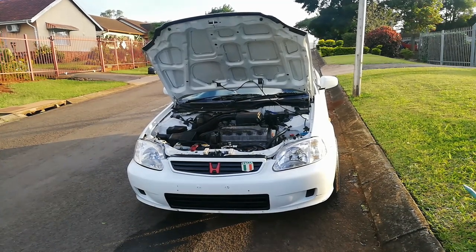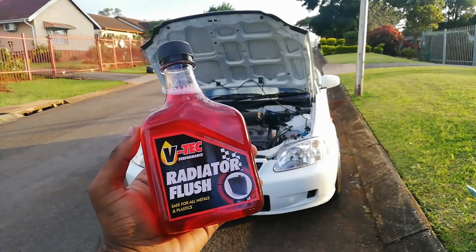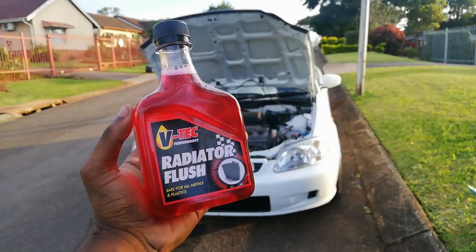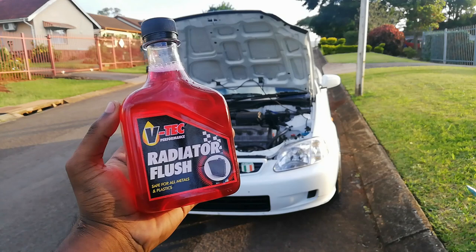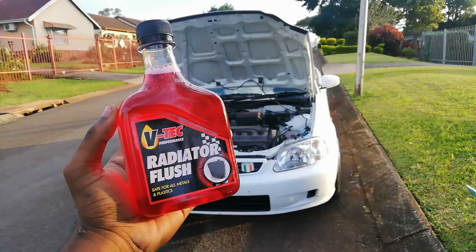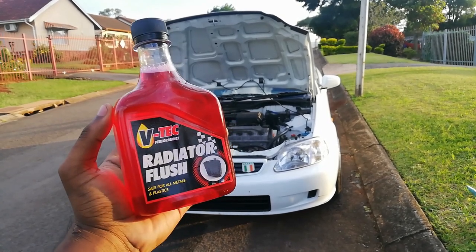This has been the last flush that I've done now. I'm going to do one more and then add some water and add this - I had this laying around in my garage. I'm going to pop this in. It basically acts like a degreaser - it degreases everything in the radiator and flushes out all that gunk and whatever excess is laying on the walls of the radiator.